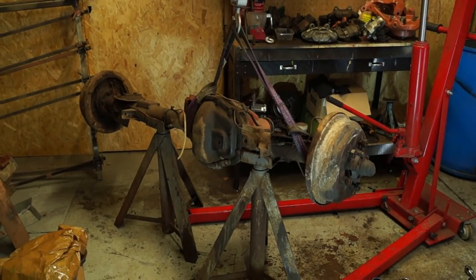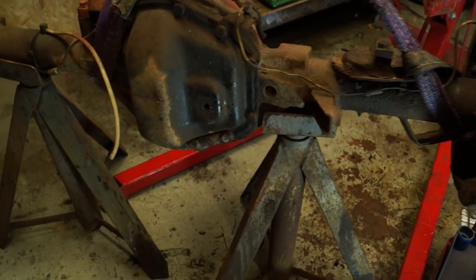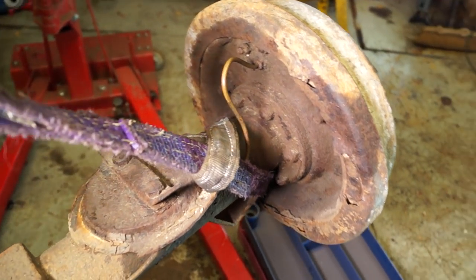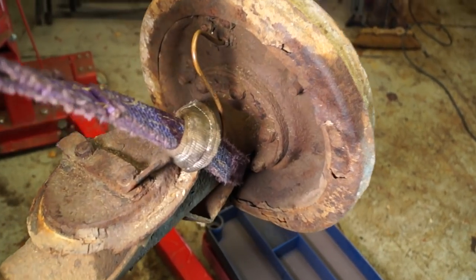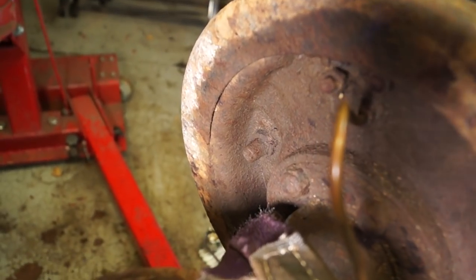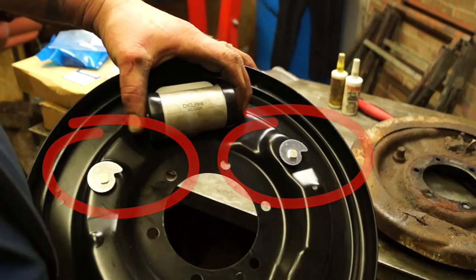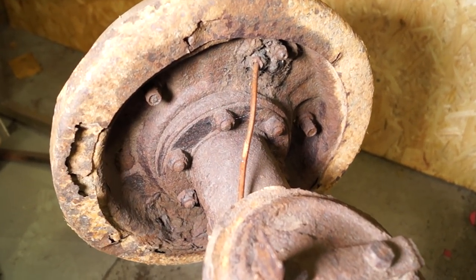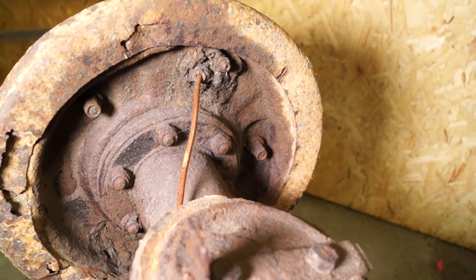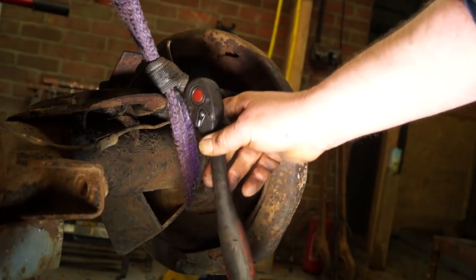What we have is the rear axle on some axle stands — we'll just have to imagine it's on a vehicle. Axle stands are taking the weight of the vehicle so it's not going to roll anywhere. On the backing plates here you have two snail cam adjusters, and you use these to wind the brakes off. You can see on the other side of the backing plate there are the snail cams, same on the other side. To wind them off, rotate the wheel at the same time so you know which way they de-adjust. De-adjust them and do it for all four — this will wind the shoes off.